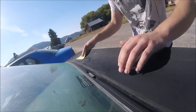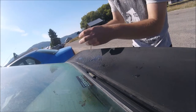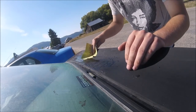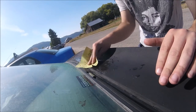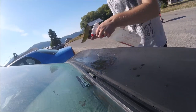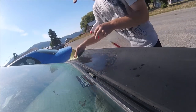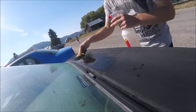Take your sandpaper and go along nice and smooth, as even as you can. Preferably you'd be using a sanding block, but I don't have one at the moment. Just go over it, keeping it nicely lubricated the entire time in order to smooth out the surface.